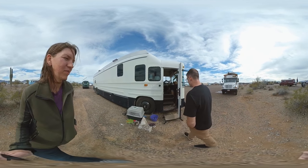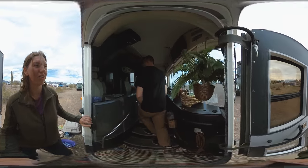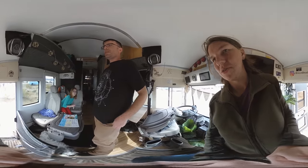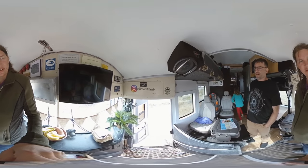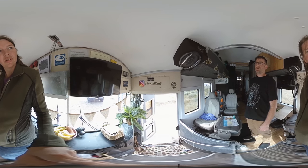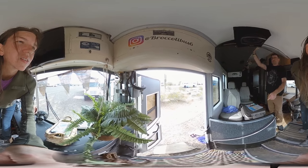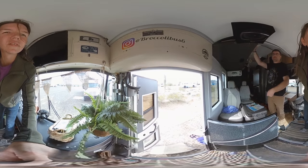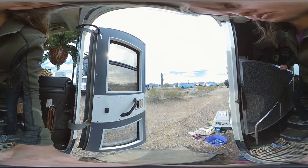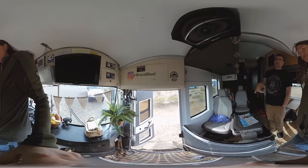Well, are you ready to go in and check it out? Sure, let's go inside. We can come out later and check out the battery system. This door here is not an original door — I built it to replace the accordion folding door. It's still actuated with the air system, so if I turn off the emergency release, I can open and close it from the air system. There's an extra air actuator in the door handle that pops the door latch and opens it, and you can lock it and open it. It uses a standard automotive bear claw latch that's both pneumatically and manually actuated.